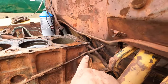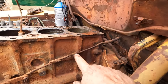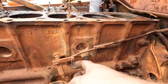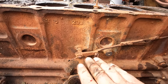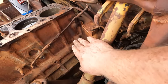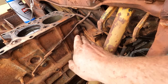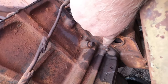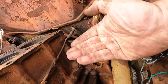I'm admiring this throttle linkage. We've got the original throttle rod going from one diameter to another diameter, welded to an extension piece, welded to the rest of it, with a piece of bailing wire holding it on and a piece of bailing wire holding a pivot on. I'm almost sad I have to remove it to take this motor out. Normally I separate the engine from the bell housing and leave the bell housing on the transmission, but you can't do that with these — some bolts you can get to, others are done from inside the bell housing. So we have to separate the bell housing from the transmission to get this whole thing out.